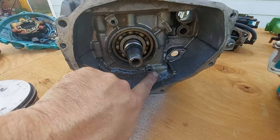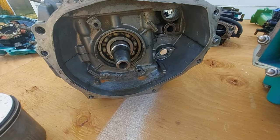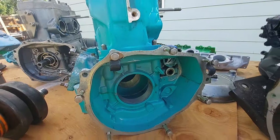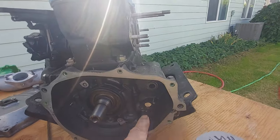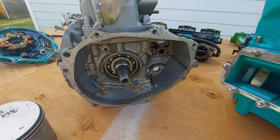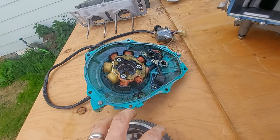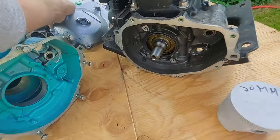This one appears to be tapped and threaded, so it's possible to run a 650 stator. Some people like to do that so they can advance the timing three degrees or so. Without tapping and drilling, this would be the stock 650 setup. You would also need to run the wire — you'd probably need to drill that out or use a rubber plug to run the stator wire out the back, because on the 750 the stator normally sits outside the flywheel bolted to the cover.